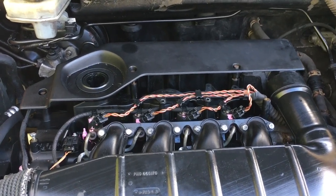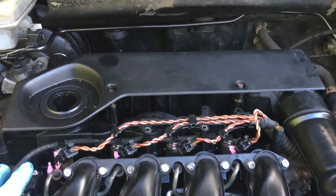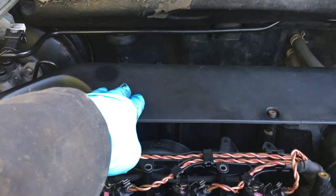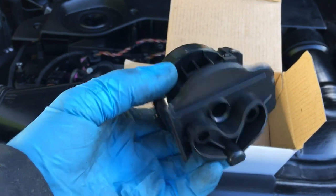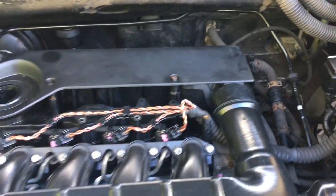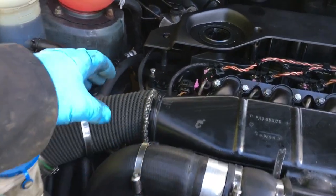I've already taken this middle engine cover off and loosened some of the fittings. This back cover needs removing — the air filter sits behind there along with the crankcase breather, and that's where we're going to put the new part in. This is the new oil separator that replaces the filter and comes with the oil seals as well. We have to remove this whole molding.